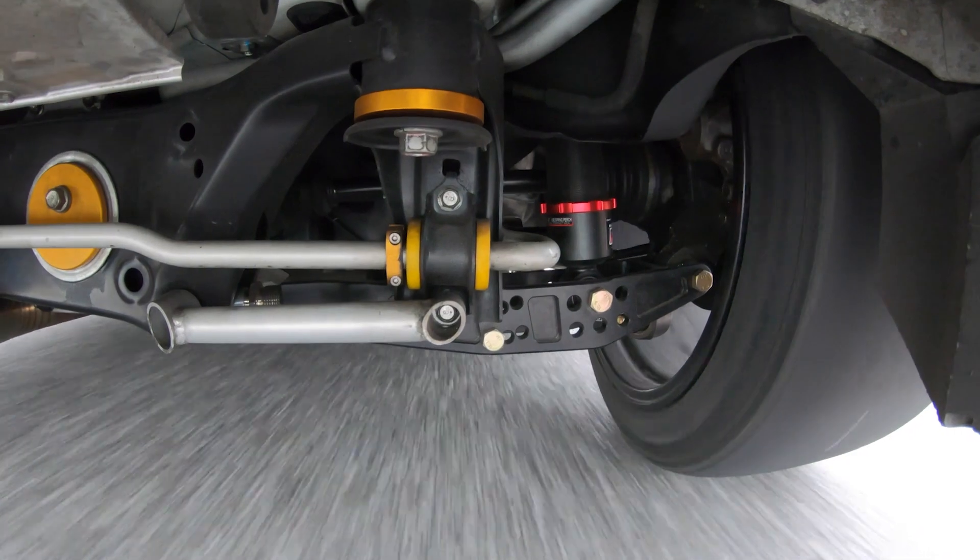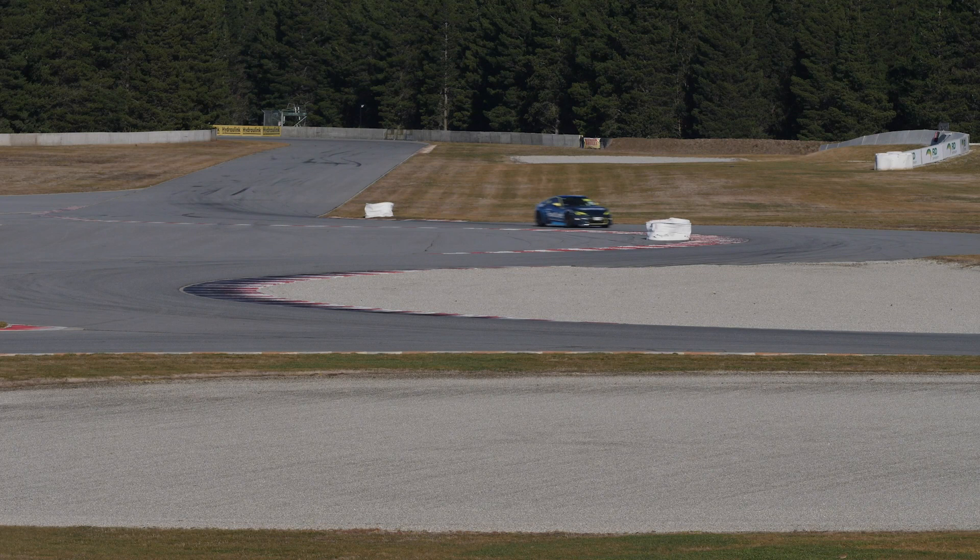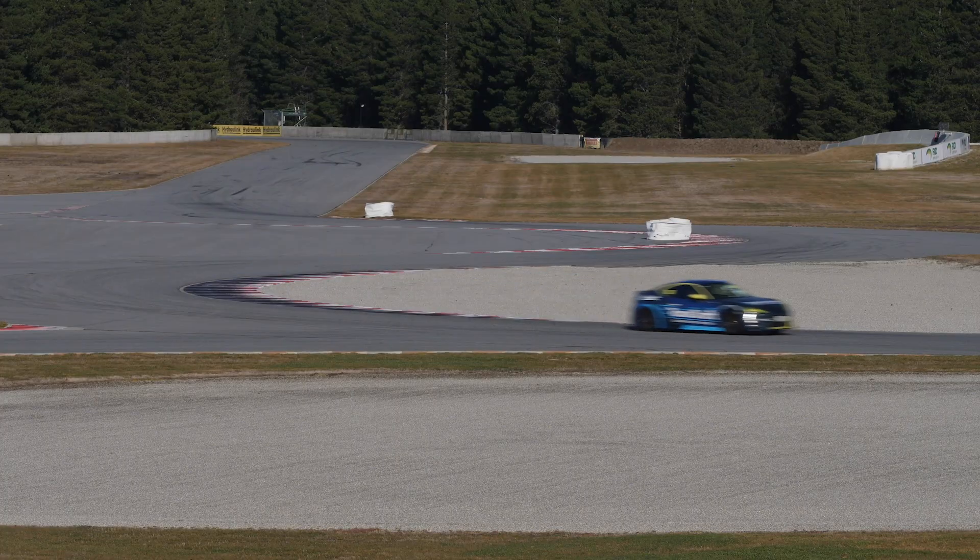This of course relies on the assumption that all of the suspension components are rigid, and generally this is a pretty safe assumption as long as the suspension is well built and well serviced. There are lots of different uses for having damper potentiometer data. One of the most obvious is just to know how much your suspension is actually moving as you go around the circuit through different manoeuvres like steering, braking, and accelerating.